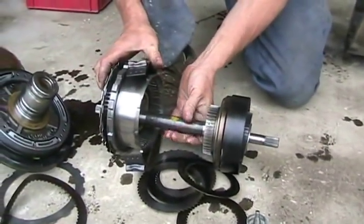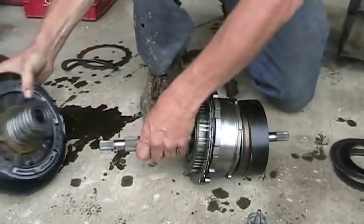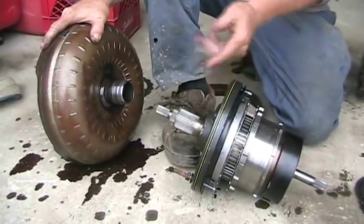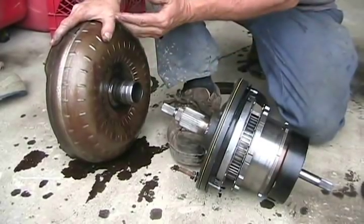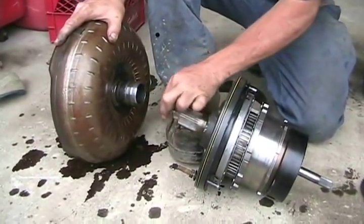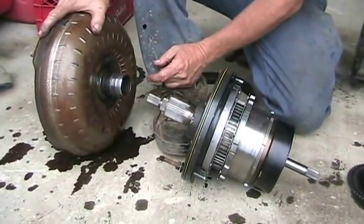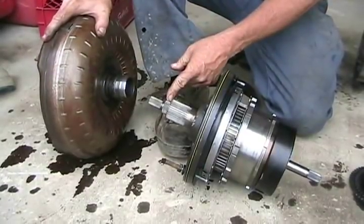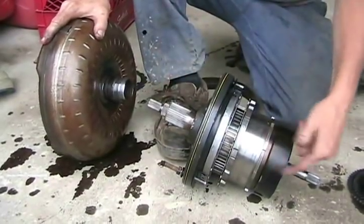This is the input shaft. This is the oil pump drive shaft. The torque converter always needs oil pumped into it, because if there isn't oil pumped in, gravity causes it to leak halfway down to the middle and it runs back into the oil pan of the transmission. So as soon as you start your car up, it's rotating this shaft and pumping oil through the spaces around here to keep your torque converter always full of automatic transmission fluid. This stationary shaft stays in position at all times, affixed to the transmission. This input shaft is where all the power from your engine — from the inside part of the spinning torque converter, which is like the clutch — drives all these clutches and gears inside.